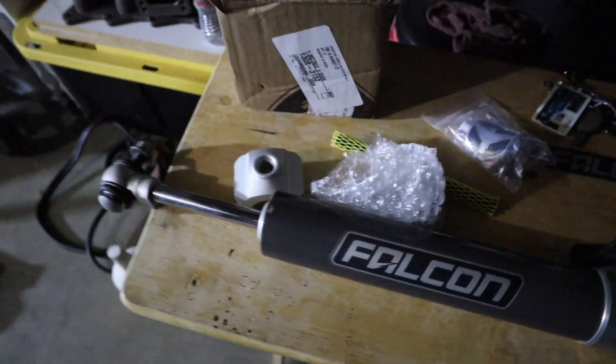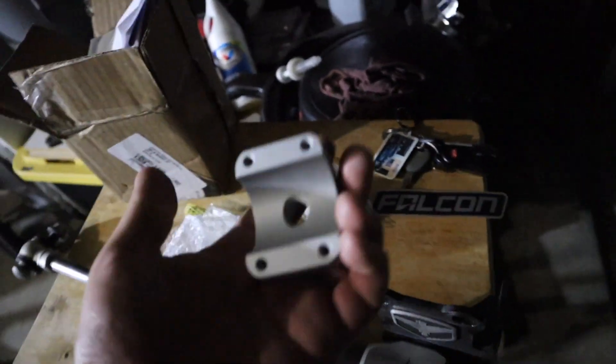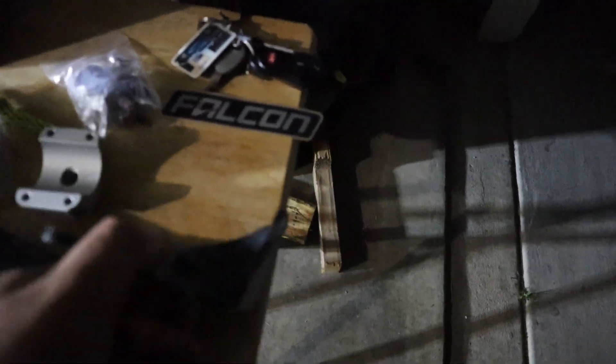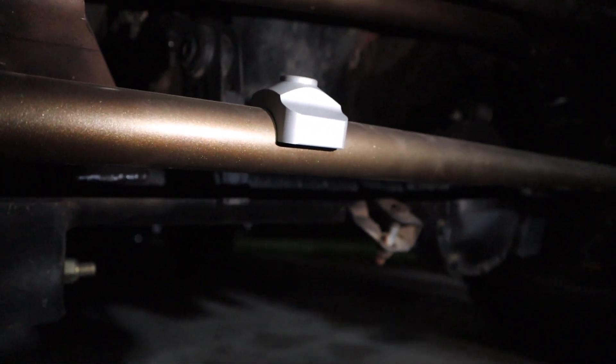To make this fit on the Jeep it's pretty simple. We have the bolt going through this right here, and on this side we have this mount for a JL or JT. I ordered this kit — these clamps come on the stabilizers for the JK. So I ordered this clamp to replace this one here. The clamp will just go over the top like that. Since I have the upgraded steering from Trail Forge, I have an open hole there for the old track bar, and if I put the steering stabilizer right there the body side goes to about the middle of the bar.